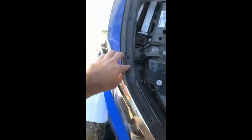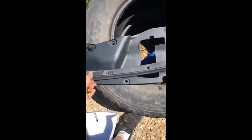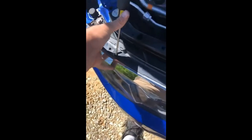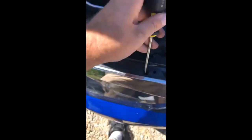Once you get this piece of plastic off that covers the condenser and radiator, and you remove the rubber strip, what you want to do next is address the little chrome strips on the top piece. You can see they're kind of loose here. Come in through these holes and try to be careful — you don't want to break this because you can sell these grills online. You should hear a pop or a click when you do it right.